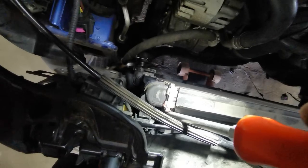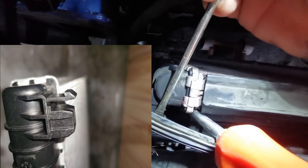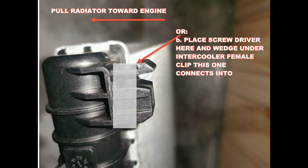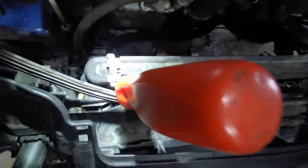That was really painful. I had to get a big flat blade screwdriver carefully in between the radiator and the intercooler so it wouldn't damage it. As I had pressure pushing back towards the rear of the vehicle, I then had to come in through the side with another flat blade and get underneath that little bracket — that little clip there. As I pushed down it just kind of felt like it snapped, but it clipped out. So yeah, it's quite dodgy.